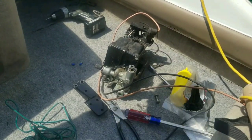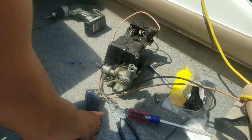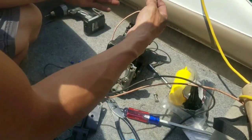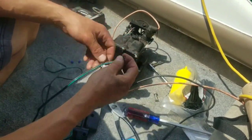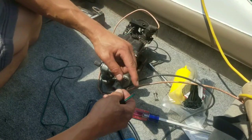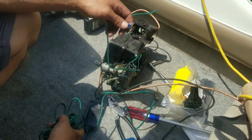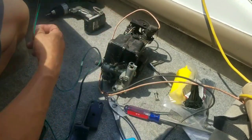Before we get into the whole mounting, putting the bracket in, installing this, and drilling more holes — I'm going to go ahead and connect the solenoid activation wires. That way I won't have to reach in there; it's a lot easier if it's out here. I'm just going to take this, splice it, strip it, tap those on, and put the wires onto the triggers. That way when I go to set it up, this is already done and I can just route it wherever it needs to go — to the controls or back here at the engine.